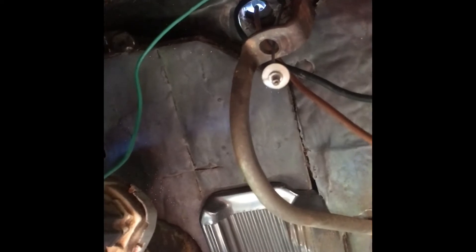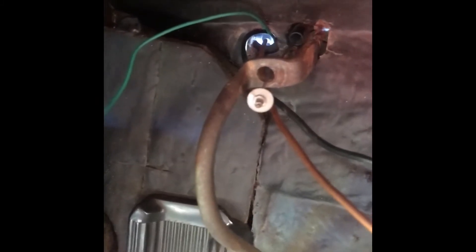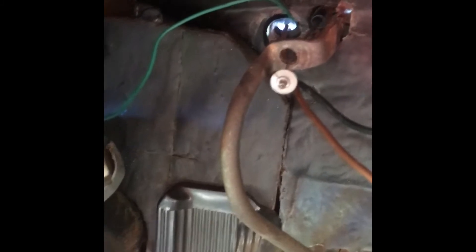Here's some bonus footage — that's the throttle works and the gas pedal assembly, the throttle cable or the accelerator cable sticking through the firewall. The plastic retaining clip that I was telling you about — it's right there, it just pushes out from the back of the pedal. Nobody shows you this; I've not seen it demonstrated to date. Be careful pulling it apart because sometimes they're brittle and they will break, especially if people have been flooring the gas pedal.